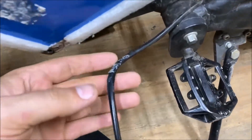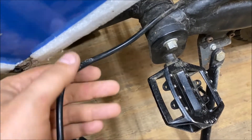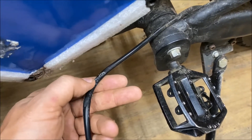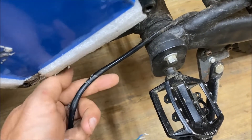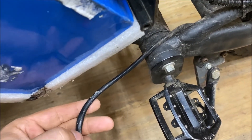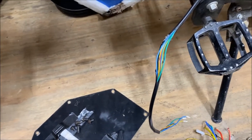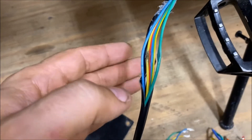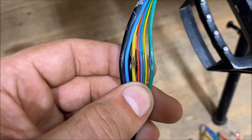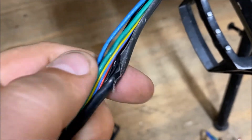There it is right there. I pull the phase wires out and you can see they've been slightly crushed by the battery pack. There's actually a tiny bit of melted styrofoam on the cable from getting warm. I cut open the cable with a razor knife and it doesn't take a really sharp eye to spot it — the green melted into the yellow, right on top of it. You can see the burn mark.